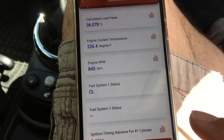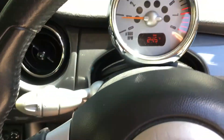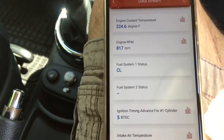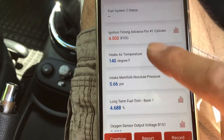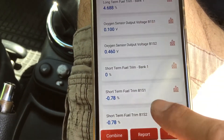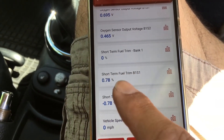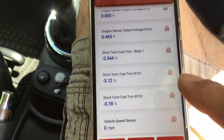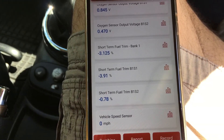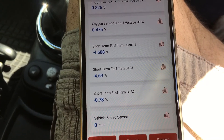The temperature is coming back down and the cooling fan has just gone back off again. It is a hot day today, so that's to be expected. The fuel trim probably just responded to all that going on - the short-term fuel trim has gone back down to about zero, which is where we'd want it to be.